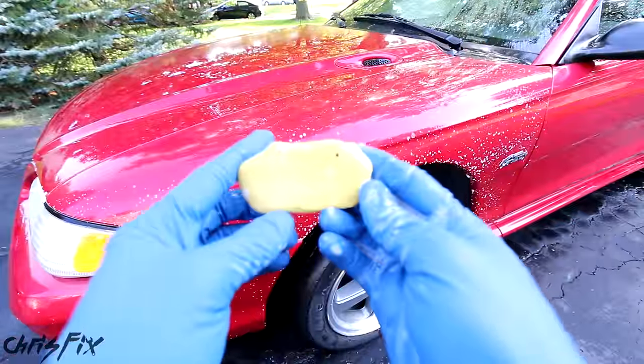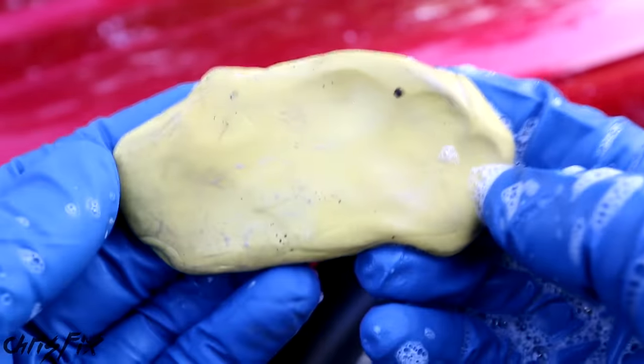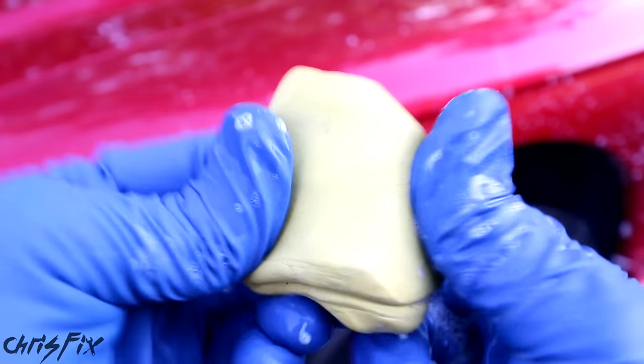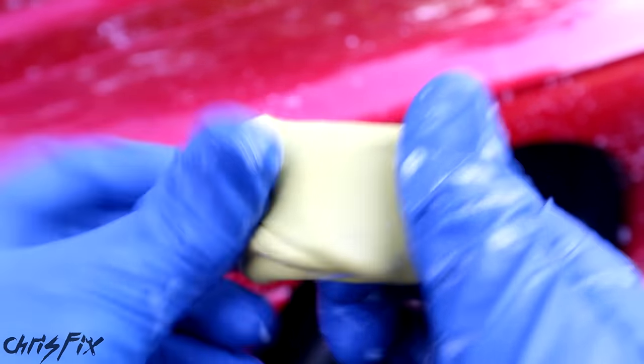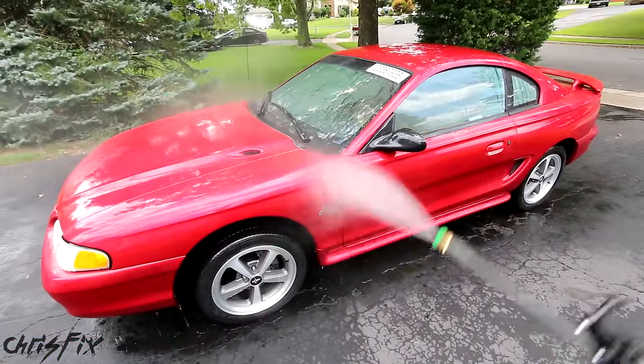And even though we just cleaned the car, check out all the embedded contaminants we just removed. And when your clay gets visibly dirty, just like this, knead it and fold it over to bury the contaminants and uncover a clean surface. And that's all there is to it. As you clay the car, remember to rinse down the paint to keep it wet so the paint doesn't dry